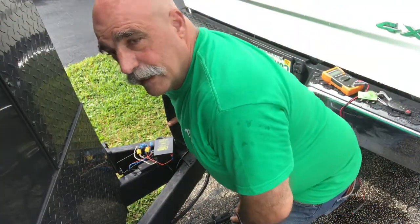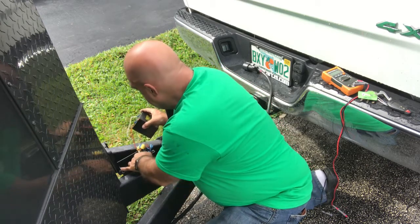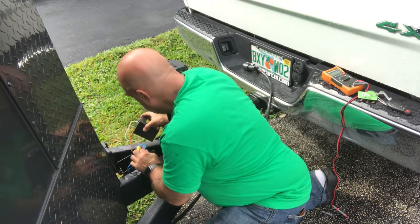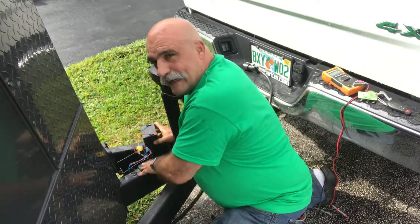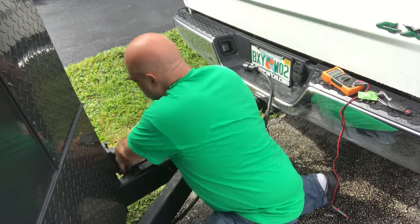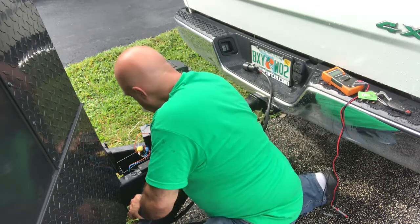This is going to make it a little easier. He has a small 12-volt battery here that handles the brakes for the trailer. The negative is the white — we know that. This is all coming from the seven pin. The white is the negative and the black here is the positive, which is running off of here, going to keep this battery charged so that he has brakes on the trailer. So all I have to do is run one more wire inside. I'm going to give it a try — if not, I'm just going to add it to what we have.